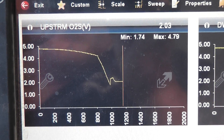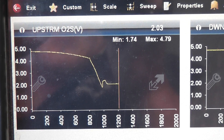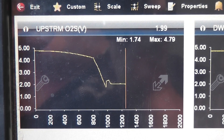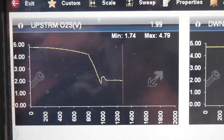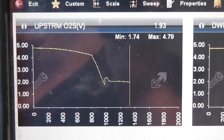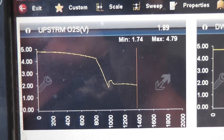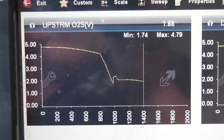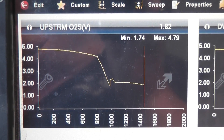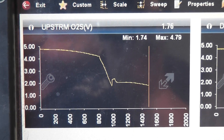What happens when you take this car for a ride with a blown heater fuse for the O2 is that bias voltage stays high because the sensor isn't warming up enough. The computer interprets any number above 450 millivolts as a rich condition and takes fuel away. Mid-throttle, fuel trims go way negative. Punch it to the floor and it runs great because the O2 is not used at wide open throttle. Runs good cold because the O2 is not used cold either.